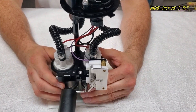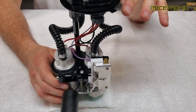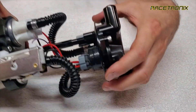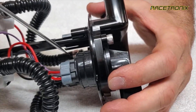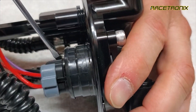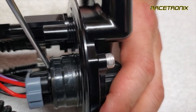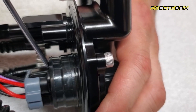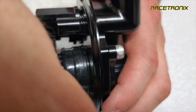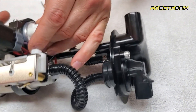The first thing we're going to do is disassemble and disconnect the fuel lines, the electrical, and the staged pump brackets. To remove the in-tank electrical connector from the bulkhead connector, you must press down on the latch on this connector while at the same time providing a subtle degree of force to get it to slide out from the socket. I'm pushing down with a small flat blade screwdriver, which pushes down on the lock, and I'm gently prying it away. You can see it just slid out from the bulkhead connector.